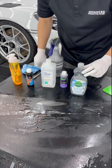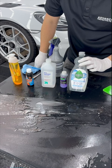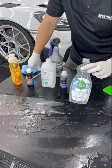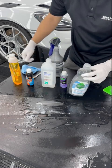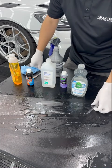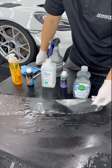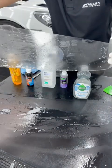Unfortunately, I stopped using Seventh Generation just for safety. If I dilute it down with a bottle of water — you get your filtered DI water, put a couple of drops in, shake it up, and turn that into slip solution — then that's no problem at all. I have not had any issues with the film being burnt. It was just when I put bare soap directly onto the PPF, directly onto the adhesive, that I had the issue.